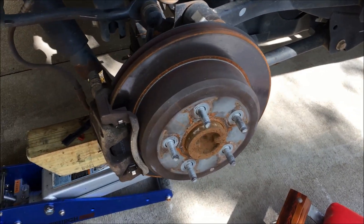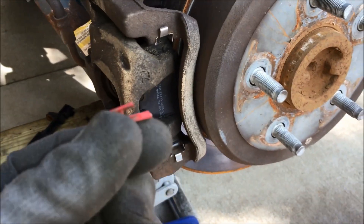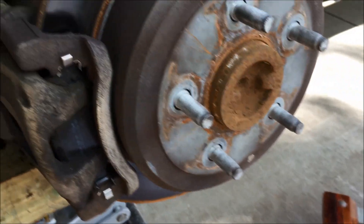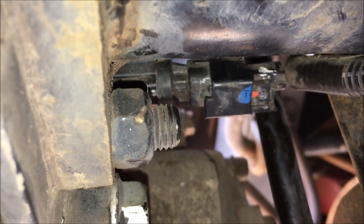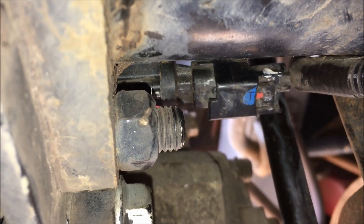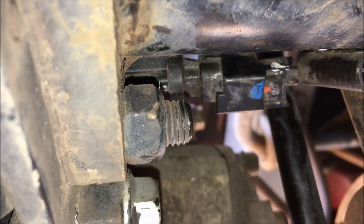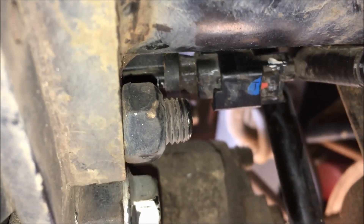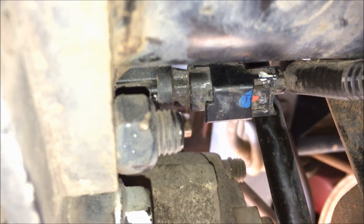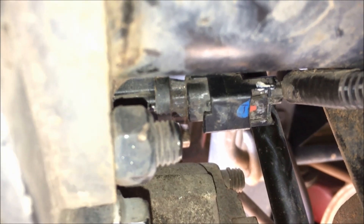I'm having a little trouble getting the electrical connector off. The tab that locks it on broke as I was trying to pull it out. I released the eight millimeter bolt that's holding this in. The problem is with the electrical connector — the sway bar end link is in the way. So I'm going to see if I can get that last piece of red locking tab out of there and release the electrical connection, and then I should have enough clearance to get that sensor out.